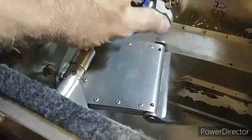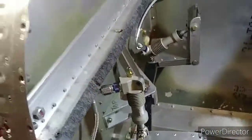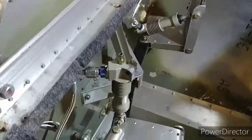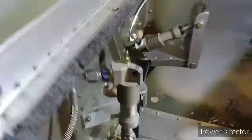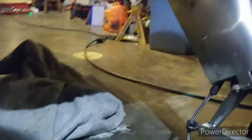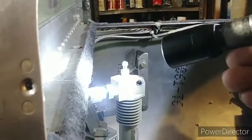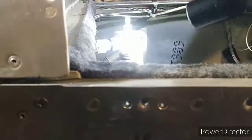I'll pull this loose from here and then put that up vertically and bleed it. I can't do the bleeding and filming at the same time — when Smokey Tom was here we could do it. But I'm going to put fluid in, pump fluid into here, and when it starts coming out of the bleeder there, keep getting air out until the bubbles stop, then put it back together and try it and see how it works.